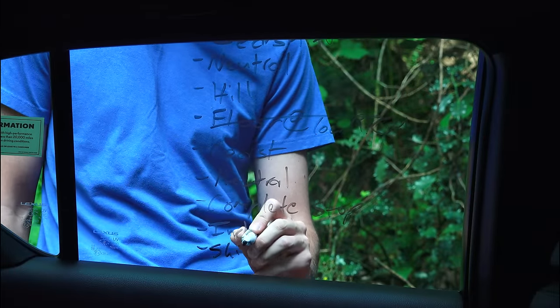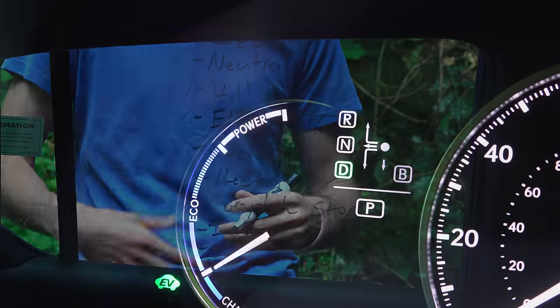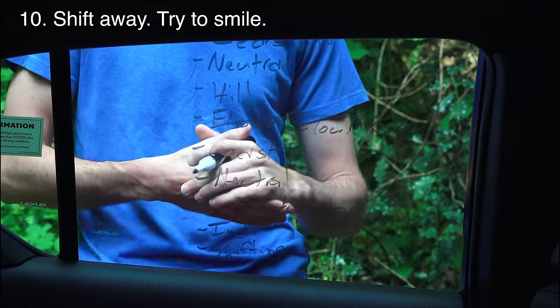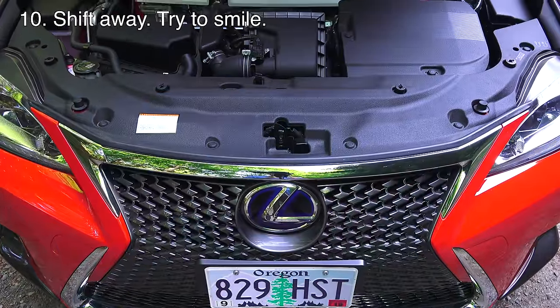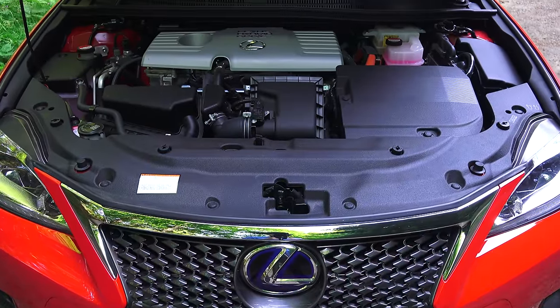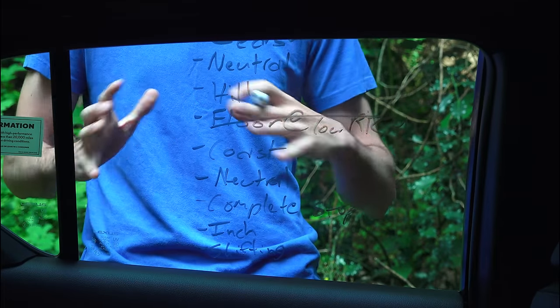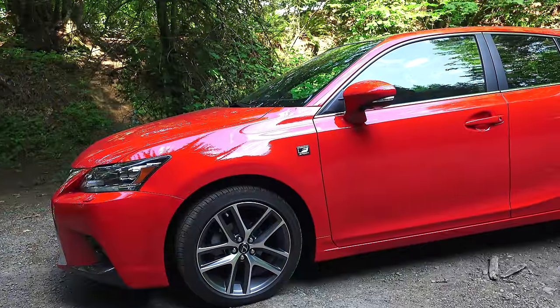Number 10 relates to shifting, which originally applied to the dual-clutch transmission and its logic. In CVTs you can do whatever you want as far as shifting goes — downshift, upshift, on the throttle or the brakes — it completely doesn't matter, it won't mess with the logic. When I say downshift in a CVT, that's because some CVTs have stepped gear ratios you can choose between. In regular automatic mode it'll just choose the right gear ratio for the driving conditions.